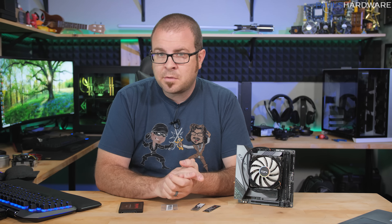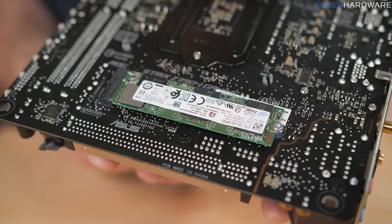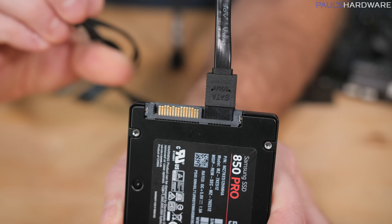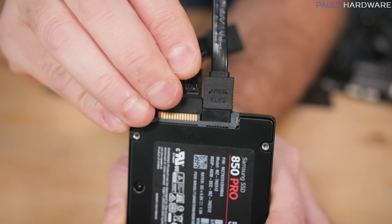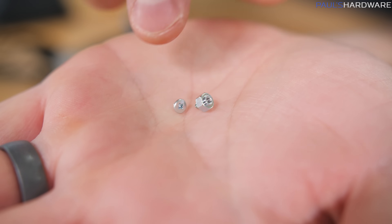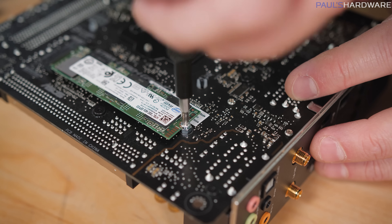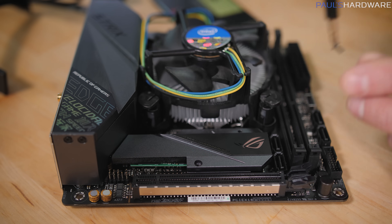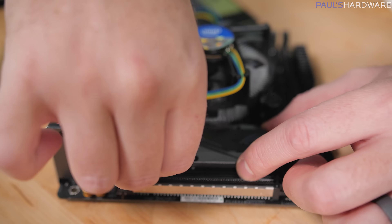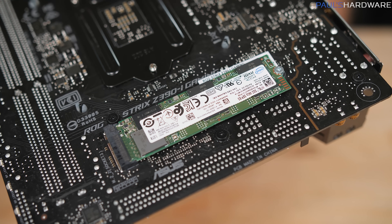My final tip involves connecting up your storage drives, and here we can save even more time by going with M.2 SSDs. While M.2 SSDs simply plug directly into your motherboard, skipping the laborious task of connecting a SATA data cable from the motherboard to the drive and a SATA power cable from the power supply, there is the possibility of delay because of the stupidly tiny screws and standoffs that M.2 drives use. Just remember that these little guys usually come with the motherboard accessories in a tiny bag, and they don't need to be super tight — just enough to hold the M.2 drive securely. Also, many motherboards have M.2 heatsinks, which aren't really necessary except for the fastest drives and heavy use case scenarios, so you can opt to go without one, or just choose a motherboard with an M.2 slot that doesn't have a heatsink.